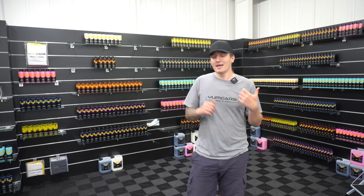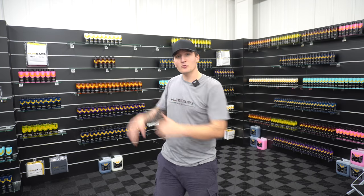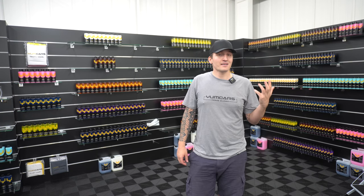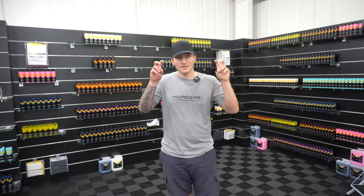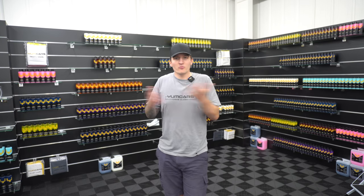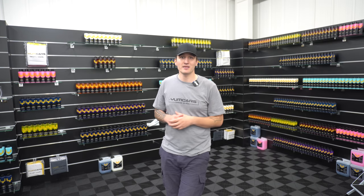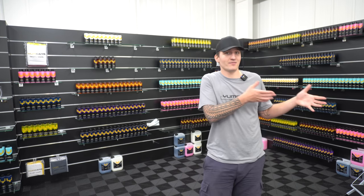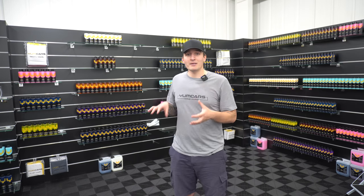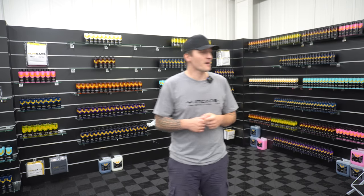Again, with mine, because stuff does fly in through the air scoops, the engine is protected. It's exactly the same thing as the paint. So if your paint is waxed and you're getting all the bugs on the front, a normal pre-rinse will remove everything anyway, usually. So exactly the same thing on the engine bay. It's not going to get as bad as even the front bumper of the car. So a good thorough pre-rinse, dry the engine bay, hit it with YumDress, done. And you just keep maintaining it like this.